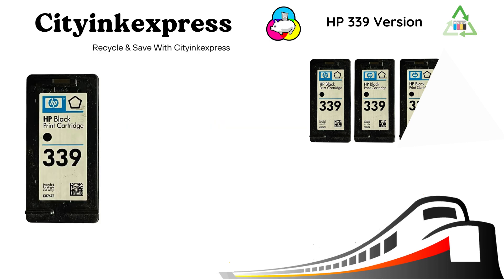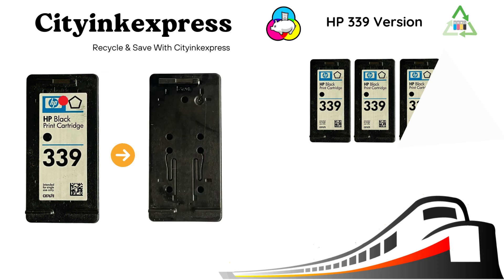There are two ways to refill a cartridge. Option 1 is through the label — the red dot here shows the refill hole. If you rub your finger over this area and press down you will be able to find the hole underneath. Option 2 is with no label fitted; again the red dots show the refill points.